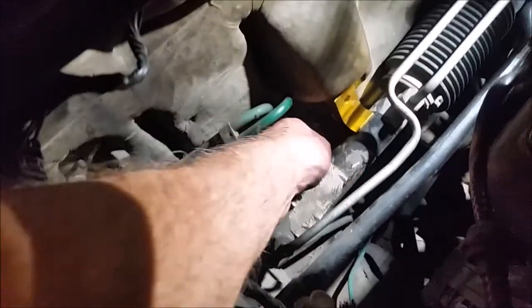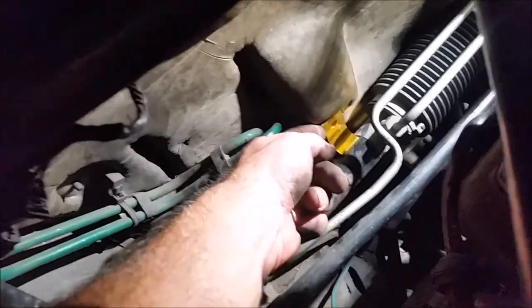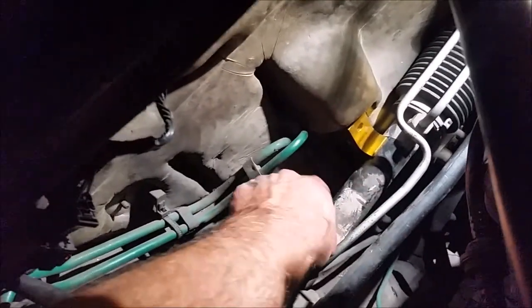Okay, there's the first part in, and the large hole goes on the bottom. You'll see, let me go over here. You see you've got a large hole and a small hole. Small hole goes on top, large hole goes on the bottom over the stud. And then when it's all done, this is going to be your nut going through it. What you do, you have it sideways, inboard, outboard, with the large hole right there underneath it, and you fit that over the stud, and then you kind of force this baby forward, and you can maneuver and swing this about the stud. You can swing it up through here and right to the position where it's at, and that'll work just fine. So go ahead and do that. There's going to be some fiddling. You might even say a few bad words. Welcome to mechanics.